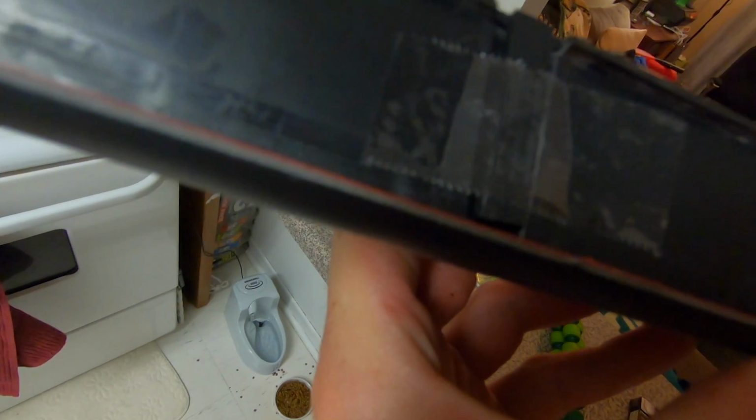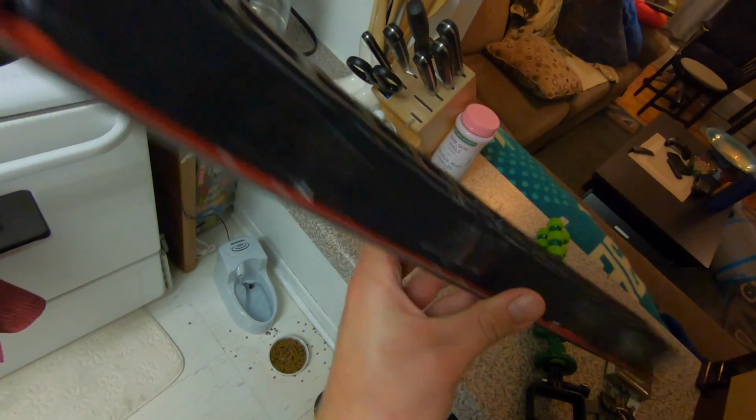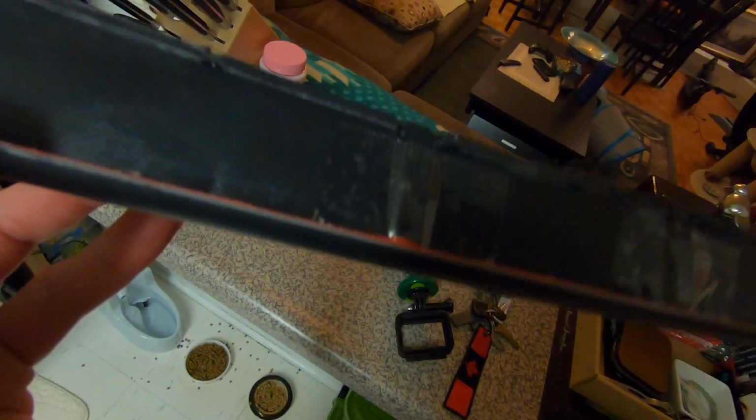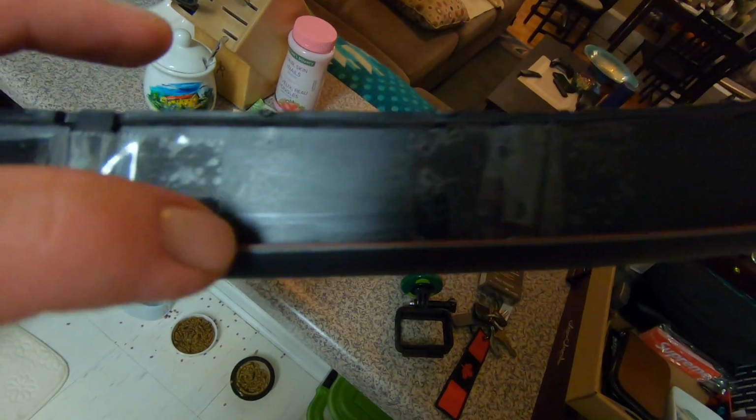And this tape is actually like a foam tape. So it has maybe, I don't know, 1/8 of an inch of foam there. So once you unstick the red backing here and you have the glue exposed, there is a little bit of a cushion. I don't know if I can show you with my finger here, but that is what's going to help it attach to the Jeep, because if there's any unevenness or any parts that don't want to perfectly grab onto the Jeep, then this will help accommodate that and fill in those little gaps.